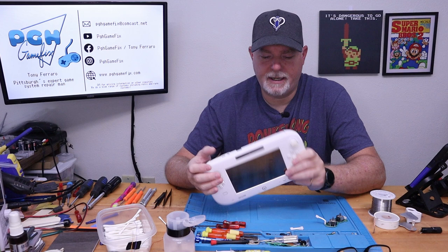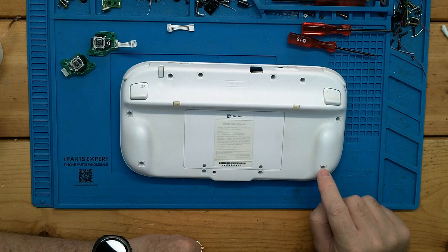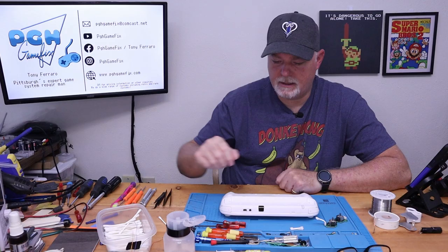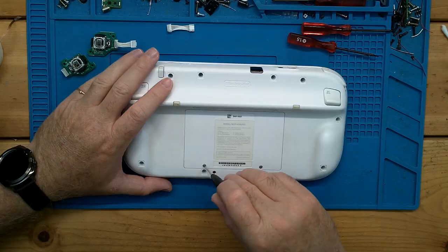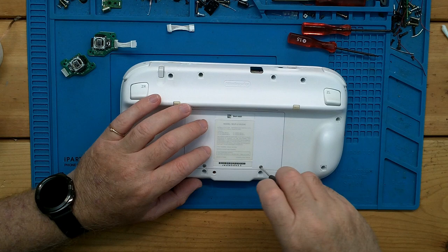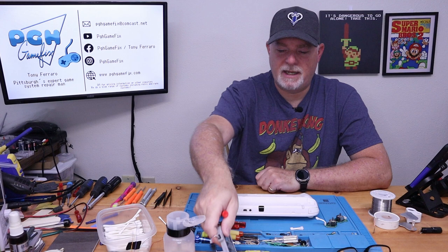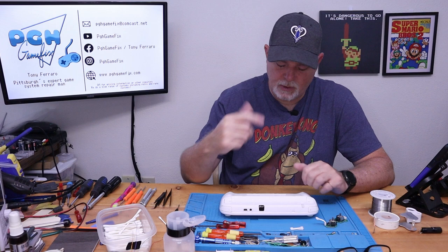This one has been apart. We can tell because in each one of these screw holes, you can see there's a little recessed square — there's normally a little sticker, and obviously they've been all peeled out. But let's first get our battery out just so it powers down. One reason is I already tested this one on my own personal Wii U just to see what it was doing, and if we're sitting here playing with it, it might be kicking my Wii U on upstairs. So the battery's out. These screws, if nobody's messed with it, should all be tri-wings. Let's go ahead and get those out.